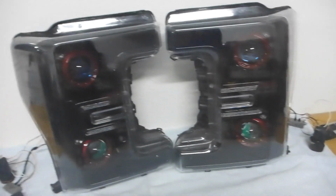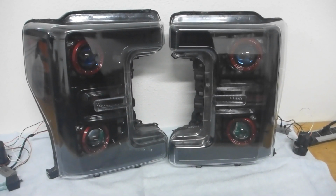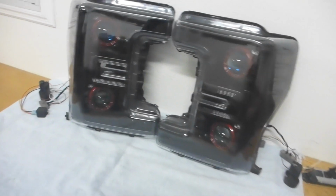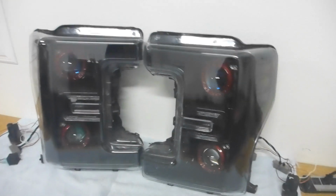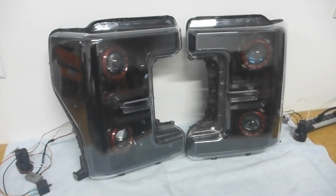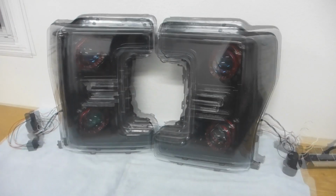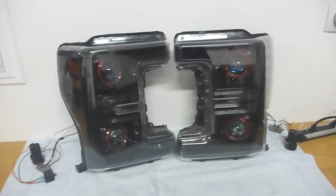And the big trick into doing that was that I had to bring them really far forward. These are not shaft mounted projectors, so it's all nut and bolt. And it's my super amazing custom patented top secret solution of a serviceable nut and bolt assembly, so they can all be removed. Also worth mentioning, these housings are not cut open. They are opened the good old-fashioned way, slowly, patiently, and deliberately. All of the permaseal removed and replaced with butyl, so these are 100% serviceable units. With that being said, both projectors are aimed appropriately, and they also have OEM adjustability for vertical adjustment, so they're going to be just like a super OEM Plus.